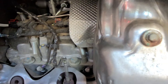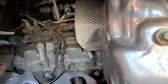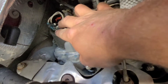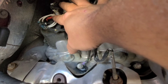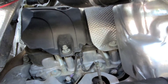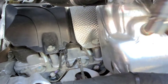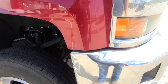I have not done 1 and 3 and I do not look forward to doing 1 and 3. On the other side there's a fuel line you have to take off. I put one zip tie kind of loosely around right here, made sure these wires were not in a bind — they're taped off from the factory. When I put the cover back on, the cover's going to hold them right down. Put the plastic cover back on, make sure it goes underneath that lip, come in from the back and down at an angle, finesse all of this — don't force anything — then one 10mm bolt, get it snug, and now it's time to put the inner fender back in.